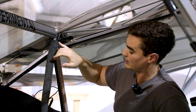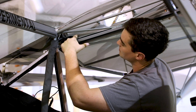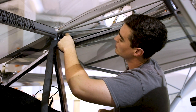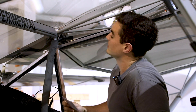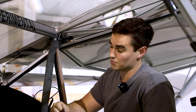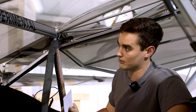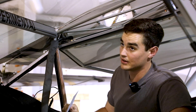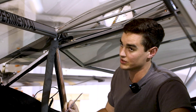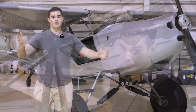Here's a potential concern I want to point out — if you have one of these, watch for this. These fuel lines here — the butt rib doesn't move, but my fuel line had snuck up into the crack on the other side and was slightly pinched, cutting off flow from my right tank into the header. I moved my zip tie up high to hold it back so it can't slide in. It's definitely going to be a preflight item from this point on. Fortunately I had about two hours of fuel in each tank and was only flying 20-minute sessions, so I had plenty of margin, but it's worth keeping an eye on during preflight and also during flight.